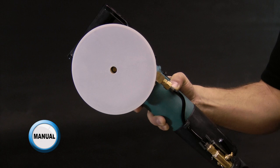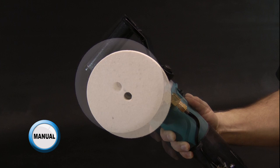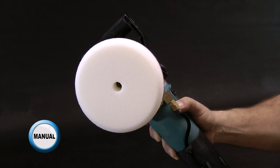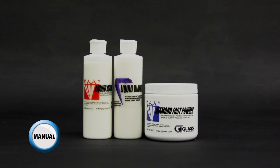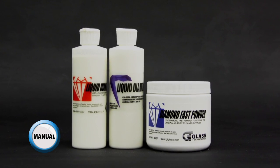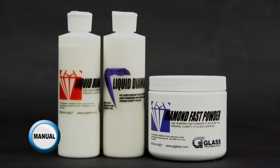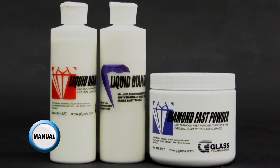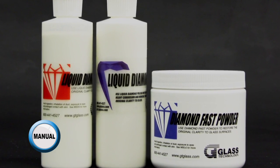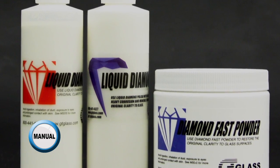Please note that there are alternatives to using the white polishing disc that are available in the form of felt and foam pads, which are used in conjunction with the liquid and powder polishes also supplied in the system. These traditional polishing options are typically used as a more economical approach to removing very light or superficial scratches, water staining, or other types of surface deposits from the glass in a single step process.